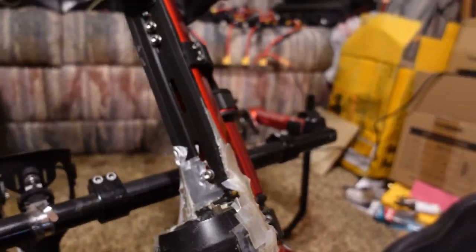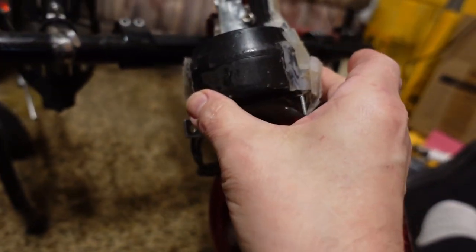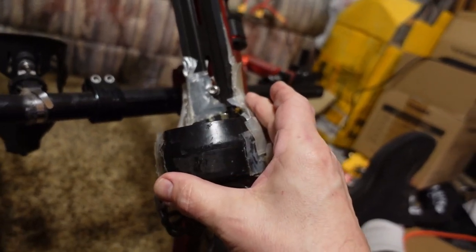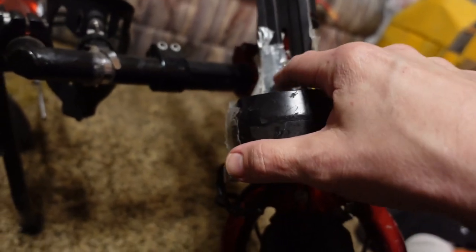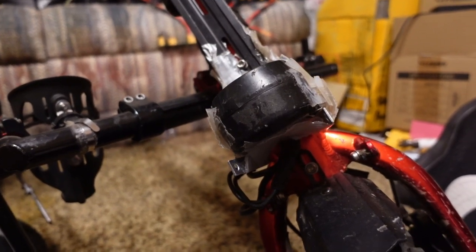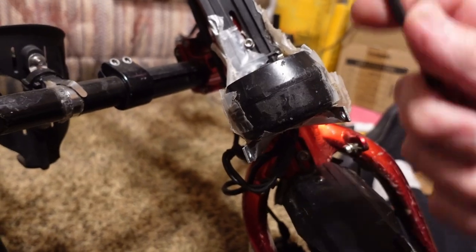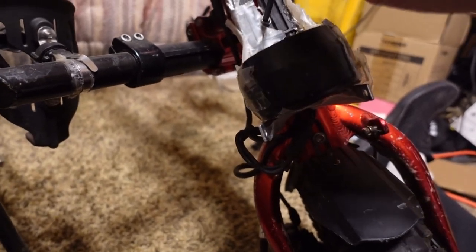The big thing I need to do is remove this piece, which is kind of a combination of the battery holder and all the control electronics. I'm pretty sure the control electronics are down in this puck. This is supposed to be one unit — he's done a pretty good job of trying to keep it glued together and taped together, but we're going to try and fix that too. Because it's a scooter, it's most likely Chinese made. I went with a five millimeter hex and that seems to be just about perfect.